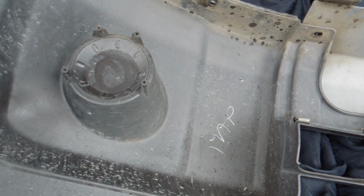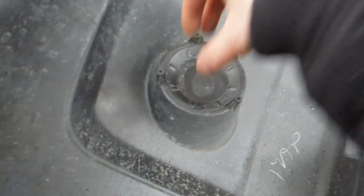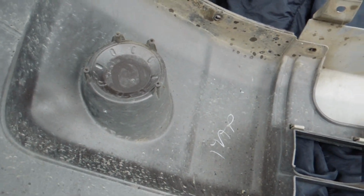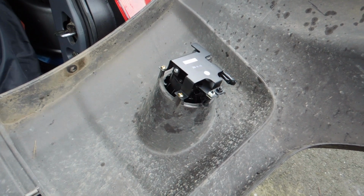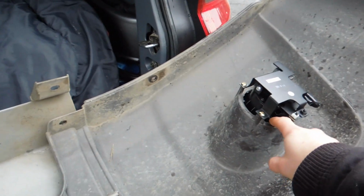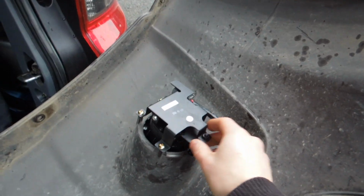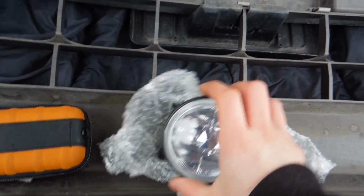So the next part is, find out where your center is on here, drill a pilot hole, and then hole saw through. Once you hole saw through, we'll start going from there. Alright guys, so our next thing is to put our fog lights in after you've cut your hole. As you see, I've got mine in. It's all good, nice and tight on this one, and that one is just the hole. So, the next thing you're going to need to do